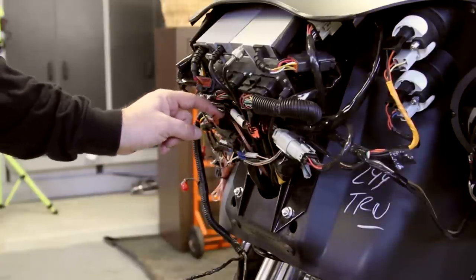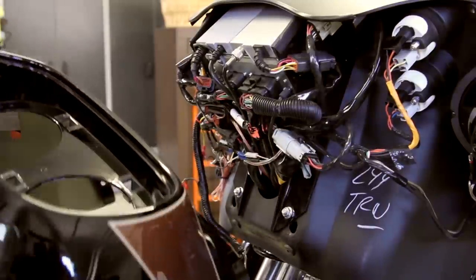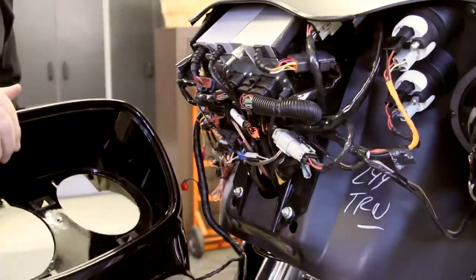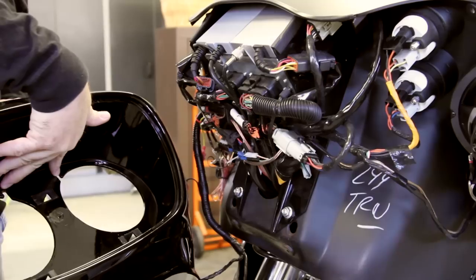When you want to mount the outside shell of the fairing, these are the two hanging points for the interior frame-mounted system for a Road Glide. I put a little orange paint on to help get separation so you can see them better. You see there's a hook here and a hook here. With those two hooks, these two mounting points correspond to these mounting points here — you can see them right there.